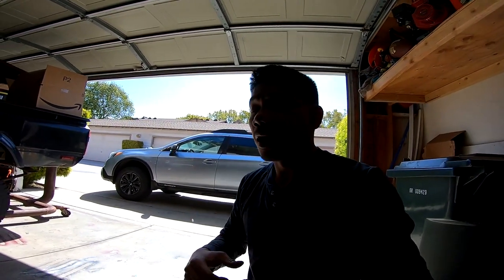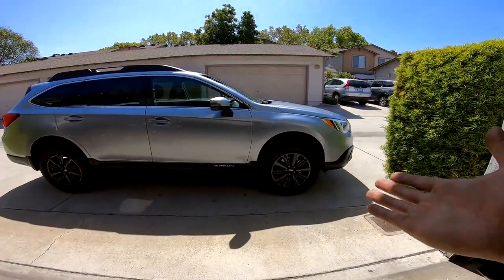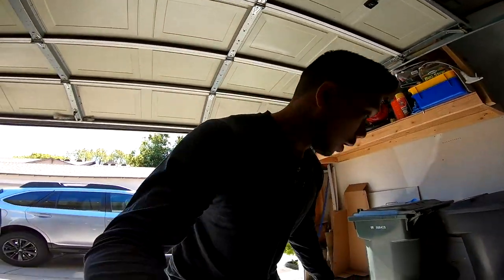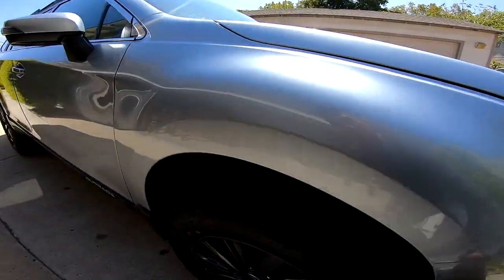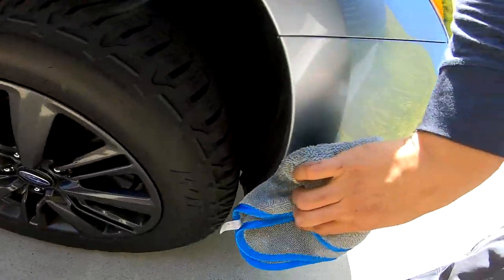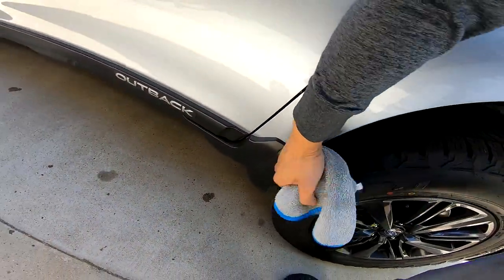Let's flip this car around. I'll show you how we put it on the blank side. This is our starting point — no arches on the car, as you can see. All the work is really in prepping the part before we stick it on. We want to start by cleaning off all of the edges that the new molding will touch, especially underneath, because that's where the double-sided tape will be adhering.